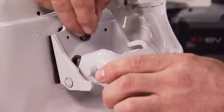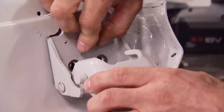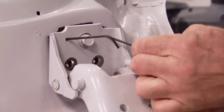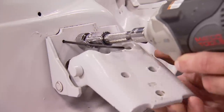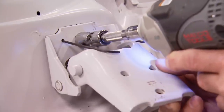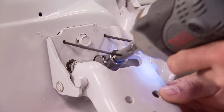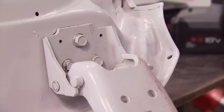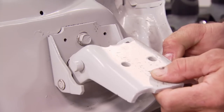Much better. We're ready to put the hinge back on the door. When I took this thing apart, I made two little 1/8-inch holes that I said I was going to use as kind of a cheater. I'll just use two little Allen keys as a guide to put them back in the holes. And what that will do — you can see by the way it lines back up with the paint — is get it real close to where it started, which will eliminate lots of time for the final fit when we put the door back on the car. You can also see that our pin kit worked because now I cannot even move the hinge.